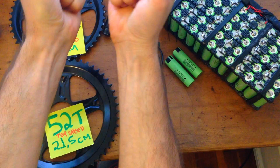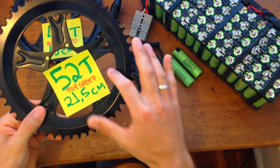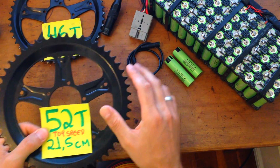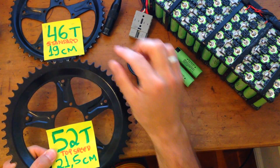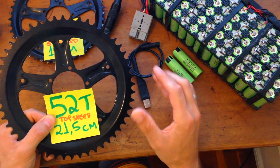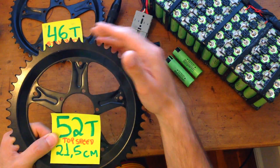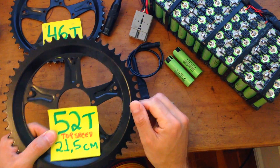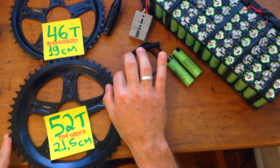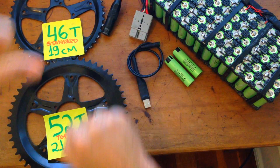But if your thing is top speed and you want to go fast, you might go and get a much larger chainring. There are actually two options available from Bafang: a 48 tooth chainring which is slightly bigger, and this enormous 52 tooth chainring — but this might only be suitable for road bikes and very few mountain bike frames. Just make sure it will fit your bike. This will also feel much heavier pedaling, especially if one day you run out of battery — you'll be struggling to pedal.